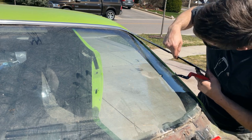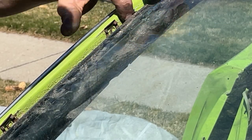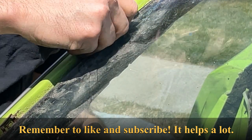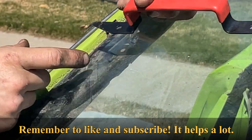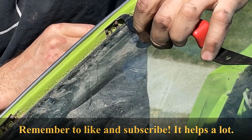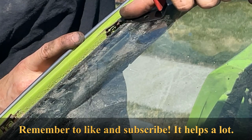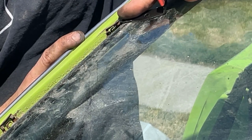So they're not all clipped — there's some glue here on the gasket. You can see the clip here; I just want to show you so it's easy to understand. It hooks over on the back, so what you've got to do is hook it and pull it forward — that's what pops off the trim. With your little hook piece, come in from the back, get behind the clip, and as you hook it and pull it forward, that's how you separate the windshield trim from the clip.